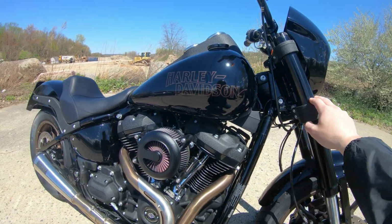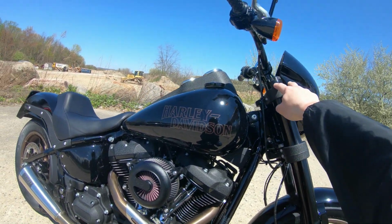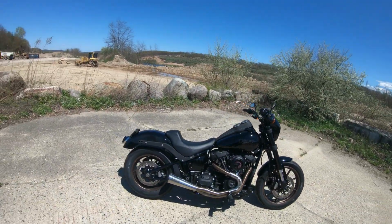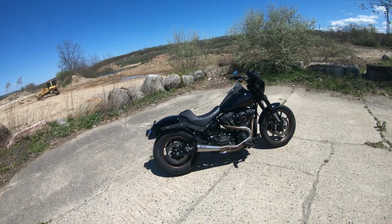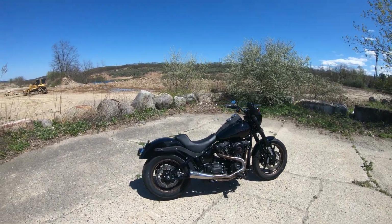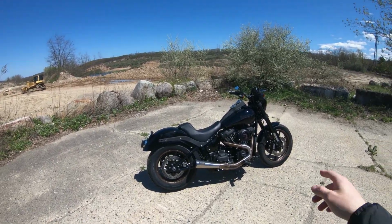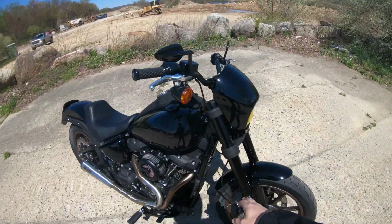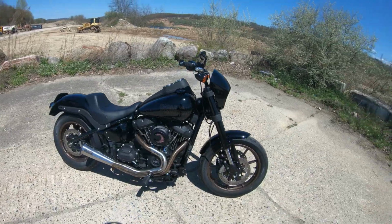And I think that raising it like that 3/4 of an inch to the rear's 1 inch raise will be a big difference, because I almost feel slightly nosediving, because this front suspension, even though these are thick inverted forks, they're a little soft for my liking.